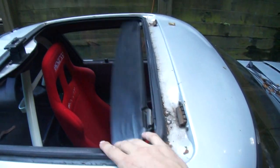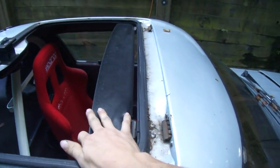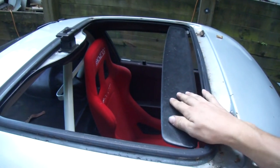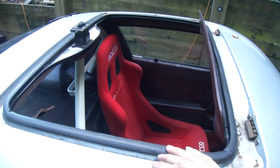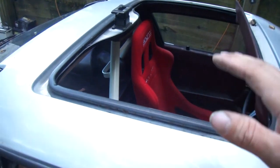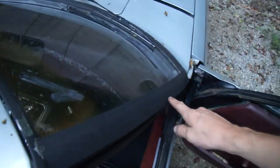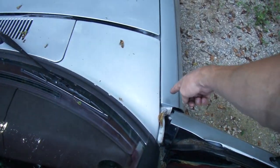The wind deflector right here makes an astounding difference. If you have one and you're driving down the road, flip it down like this — the wind will keep it there. Notice how much extra wind noise happens inside your car — a lot. The other thing: sunroof drains. This drain goes down the A-pillar and out in the back of the fender. This drain right here comes out this vent. You can clean these with welding wire, a coat hanger, a long screwdriver, or blow it out with air. Typically if you have sunroof rust, it's because the drains are clogged up.